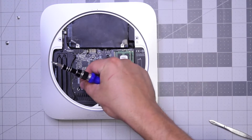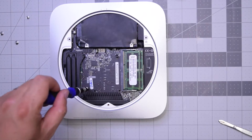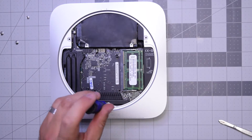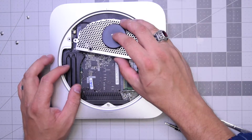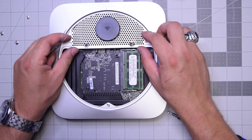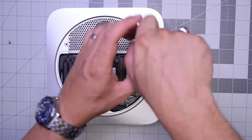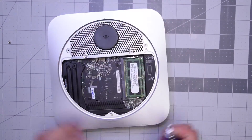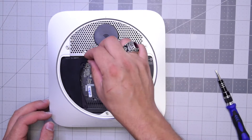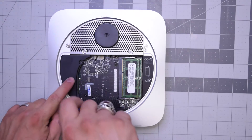The seventh connection is the fan. Pop in the T-screw securing the logic board. Align the Wi-Fi antenna in the correct orientation, put its cable over the Wi-Fi card clip, and pop it into place — make sure it's nice and tight. Secure the bottom two T-screws first, then the two T-screws on the right and left. Now place back the bracket, which is designed to protect the heat sink from the top of the case, and secure it with the T-screw on the bottom only.